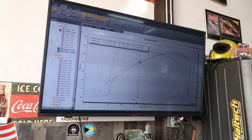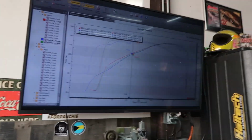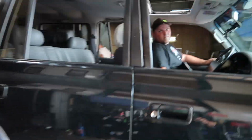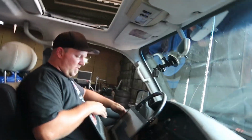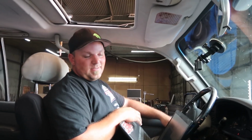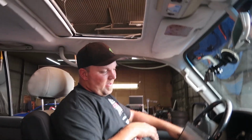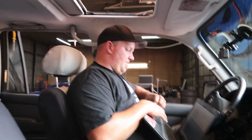One made a little bit more on top and a little more torque, 192, so it was coming back. I don't really know if I want to go much leaner than that. It's messing with you, huh? It needs the wideband in a better placement. I mean, that I read like 14.2. Yeah, it responded everywhere.